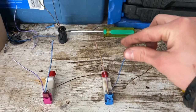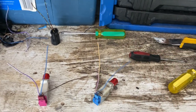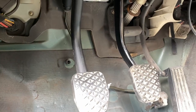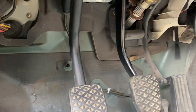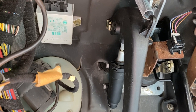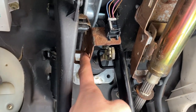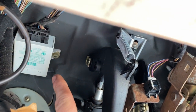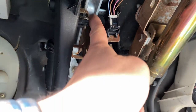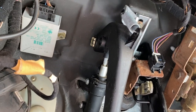On the front portion of the car, this switch right here — the signal wire is going to be going inside the car directly to DME pin 23. Then this other one is going to be going to the EWS. If you're looking at your pedal assembly from the front, and you go up to the side, that is your EWS right there. The blue signal wire, which is pin 2 on the red switch, is going to be sitting at the back of the clutch — that is going to be going to pin 8 on the EWS. The other blue signal wire on the blue switch, which sits at the front of the clutch, is going to go up into your engine bay and then to the DME.